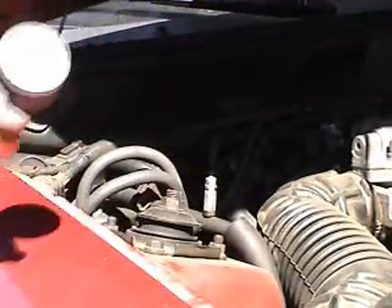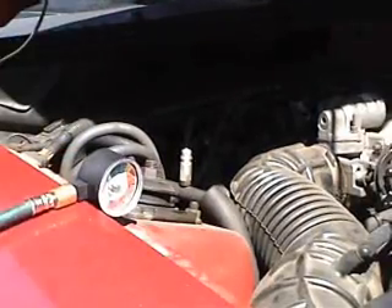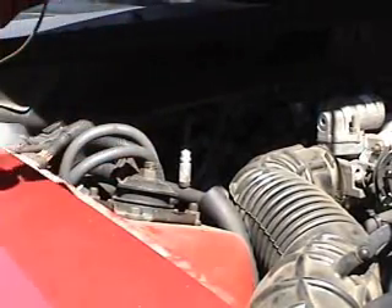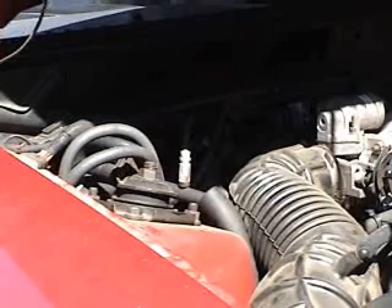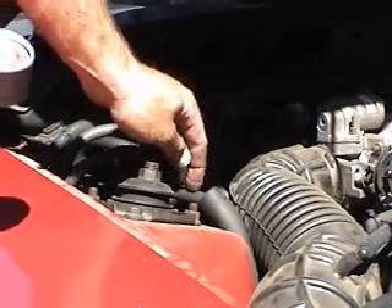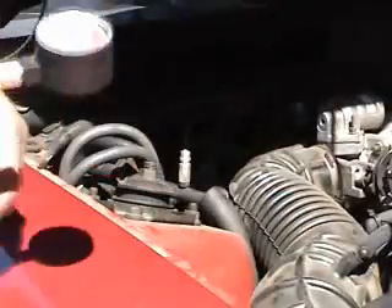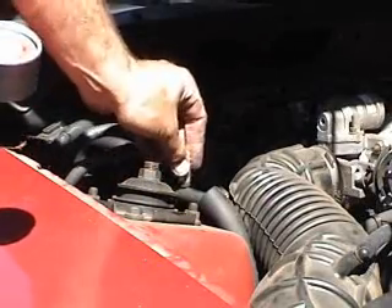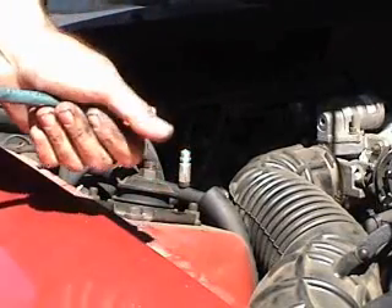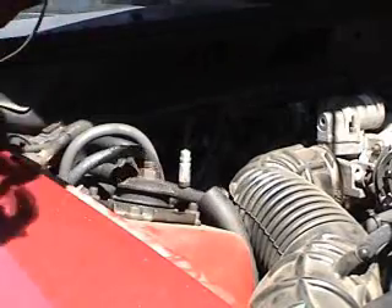As I stated earlier, we've gone ahead and started the car and turned the air conditioning on. It's on max air, so it should be pumping. Now we've got the car turned on, air conditioner on max air — the highest setting. We're going to hook the gauge up to our low pressure service port, which is the suction port that goes into the compressor. You never want to make the mistake of hooking it to the other one, which is the high pressure hose. Usually they have a different size fitting so it's impossible to mix them up. This hose will usually only fit on your low side fitting, but that's one reason we're taking a pressure reading before we attempt to charge the system — we want to make sure this really is a low side fitting.